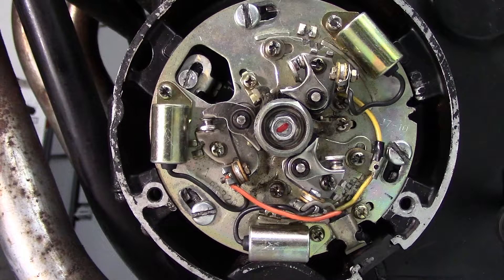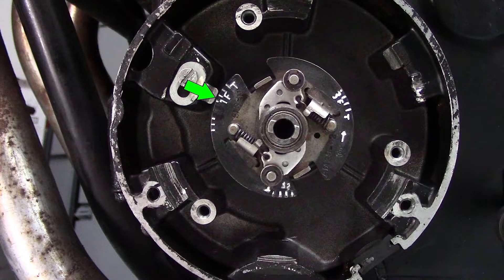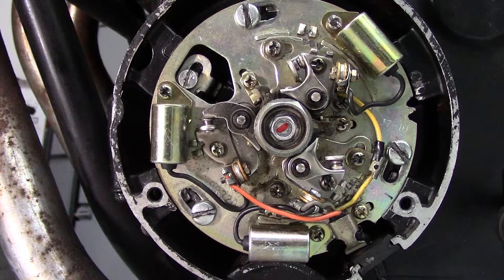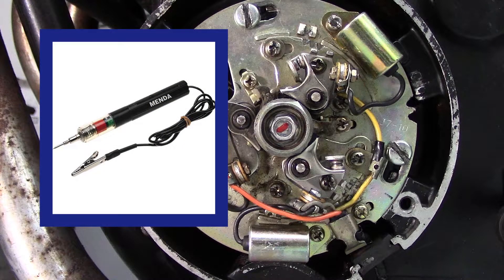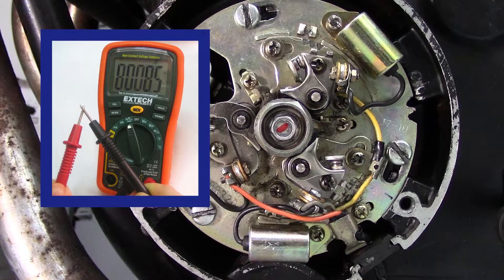Because the entire system is mechanical, setting the ignition timing on a points system is an involved but pretty straightforward process. The timing wheel has marks to show the point in the engine rotation where the spark plug should fire. On this timing wheel, it's marked with the cylinder number followed by the letter F. To correctly set the initial timing, the points need to open right as the timing pointer reaches the F mark on the wheel. I find the easiest way to do this is with a continuity tester. The most common design has a battery and a bulb that lights up when a circuit is completed.